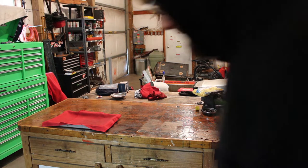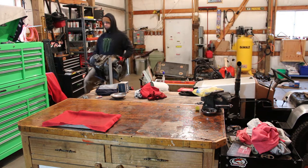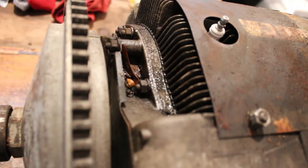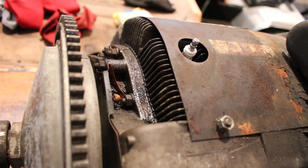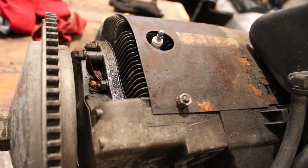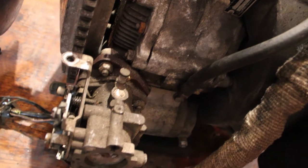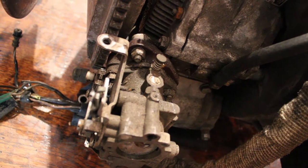There's a good deal of oil all the way around the outside of the case, but it looks like it's starting from up by the spark plug hole. I'm assuming that's from the WD-40 I was spraying in there yesterday just trying to get it to pop off. The back side is dry, so that's a good thing — I don't think that seal is bad. For right now, I want to pull the carb off and then flip it over and take care of that secondary air valve.